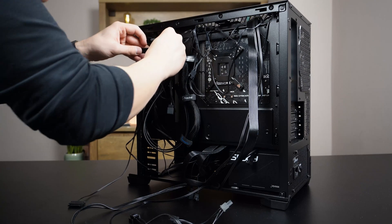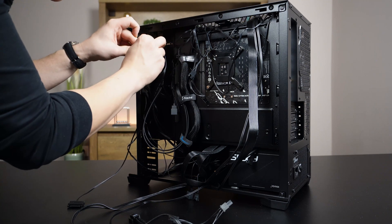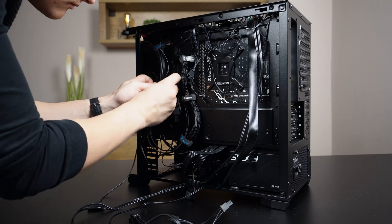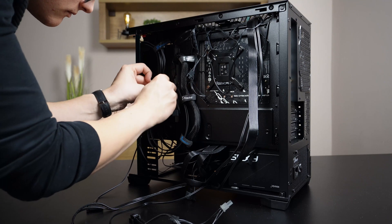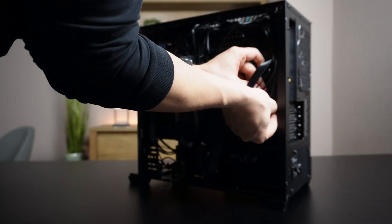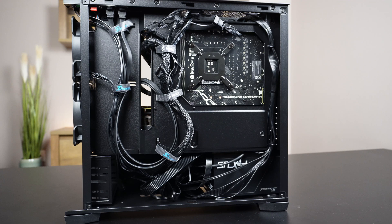The next step is cable management. I start by sorting the cables and identifying their routes as best as I can. My plan is to have three channels going down to the basement: one from the front I/O, one from the motherboard side where the 24-pin connector is, and one from the CPU connector down. After a little bit of sorting and untangling I got it to an acceptable level. I can get it looking neater by tying down the cables at more points, but I also want to keep it easy to service — tying cables at too many points makes it hard to change or add a cable.